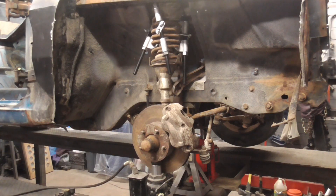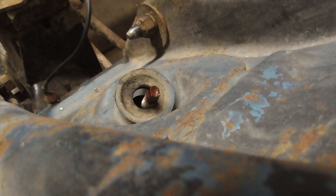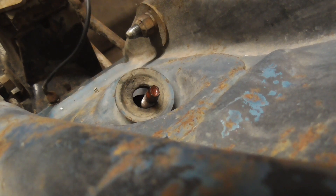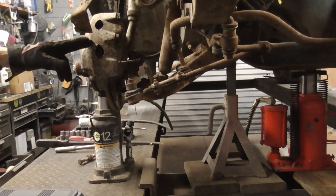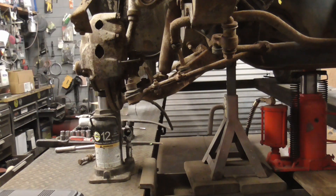Today we're going to take a quick look at a safe and easy way to remove the coil spring from an early AMC trunnion suspension. First, pick up the Fairmont Tools three-piece external spring compressor set from Eastwood. Next, remove the nut from the top of the shock, then jack up the car, remove the tire, and let the suspension hang as far as it'll go.